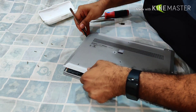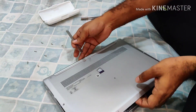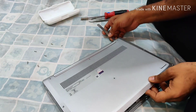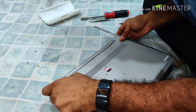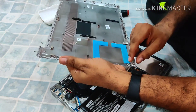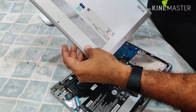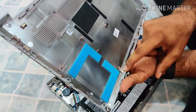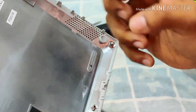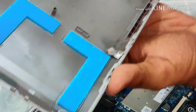The panel on this side is not responding well, so I'll try to put my tool inside and let's see how it pops out. I'll do the same from this side as well. You have to be careful not to damage the underlying electronics. I feel I have taken out this back panel mostly. These strips were the reason I was not able to take those screws out — there are three stuck nuts here, and there's a little gasket-type thing and a metallic tape strip preventing the nuts from coming out.